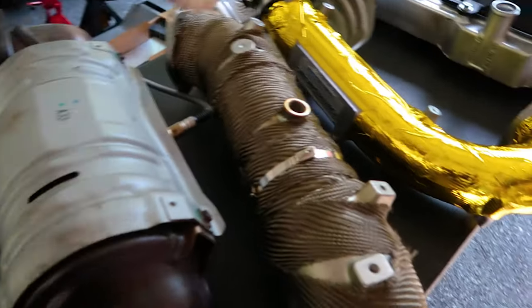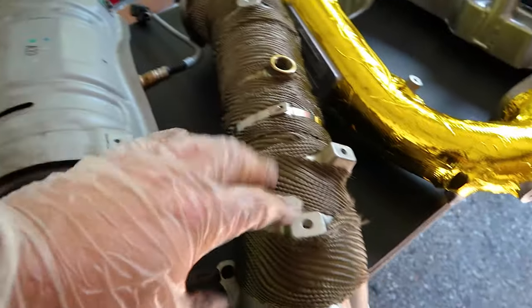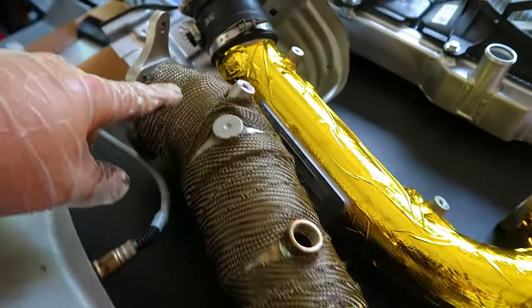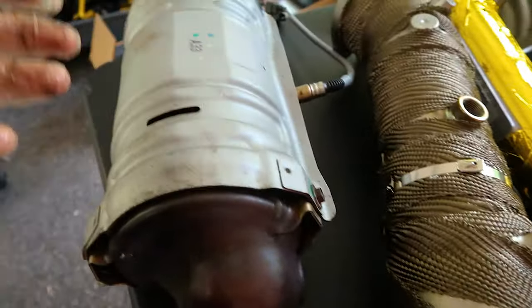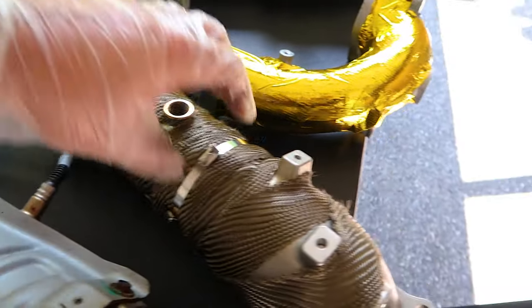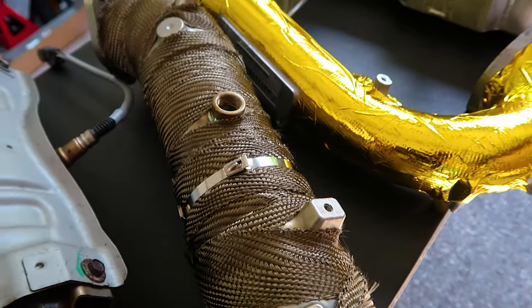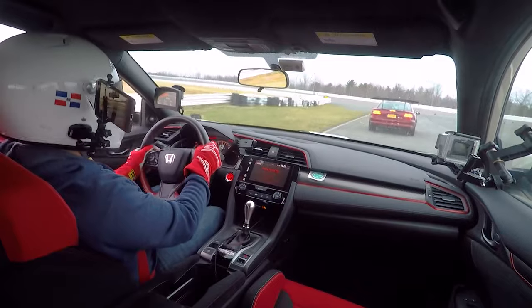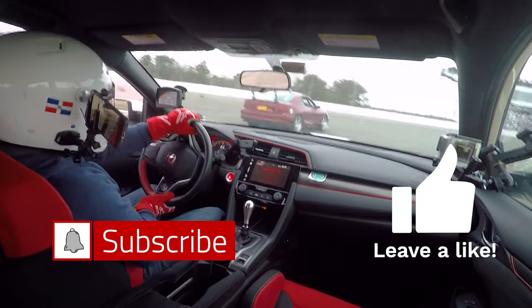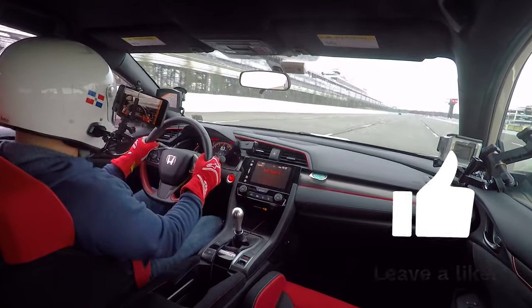I also definitely recommend taking that big nasty stock downpipe out and getting an aftermarket one. This is a PRL downpipe — as you can see, there's a key thing missing. I've wrapped it, and there are a lot of bungs and holes I have to keep available because I'm going to reinstall the heat shield, which is also a good thing for mitigating heat. The gold reflective tape is going to go a long way to help the intake runner stay cold. I hope you enjoyed the video — if you liked it, hit the subscribe button and the like button. I truly appreciate it. Catch you guys next time, peace.